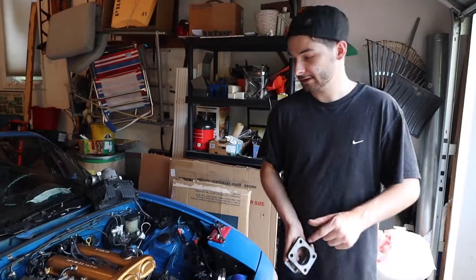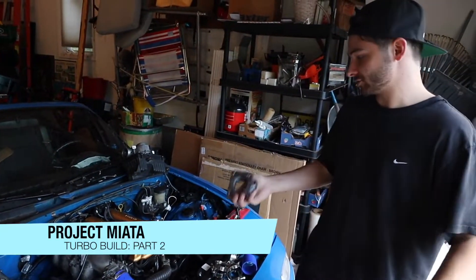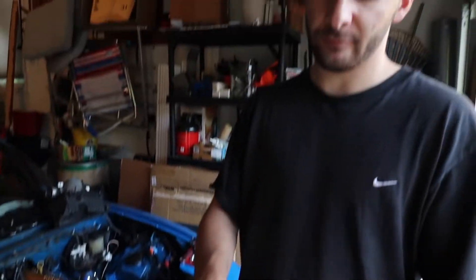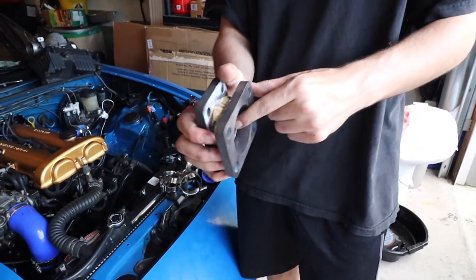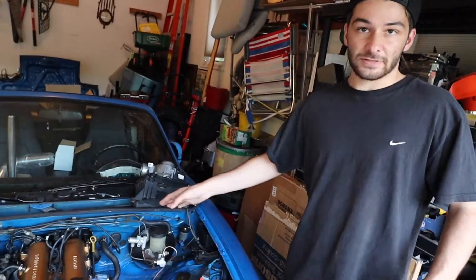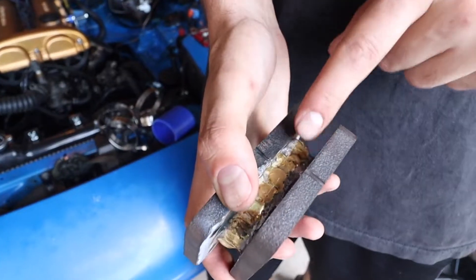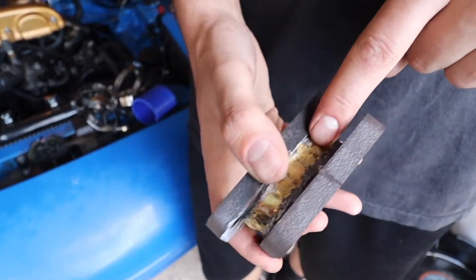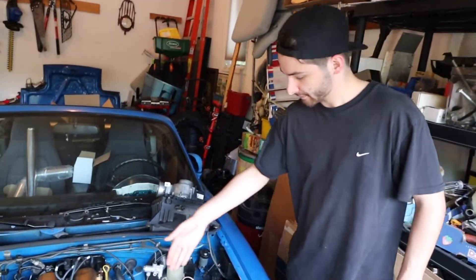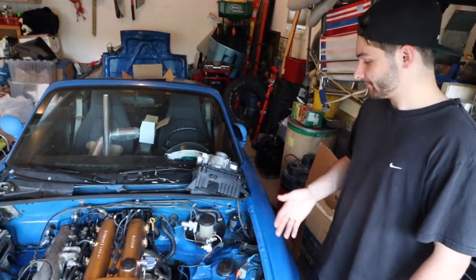What's going on everybody, Ratchet Wrench is back for another video. Today we have Project Miata, part two of the turbo build - actually installing the turbo. We had a hiccup: the adapter that went from the turbo manifold to the turbo was a little too long, so it took up too much space and the turbo was hitting the brake lines. We took about an inch off and welded it together. Cast iron is extremely hard to weld, so we put a nice bronze braze on top of it as well. Now the turbo slides by without hitting the brake lines and the master cylinder - tight, but it does the job.